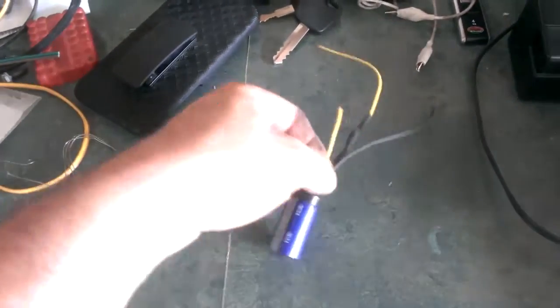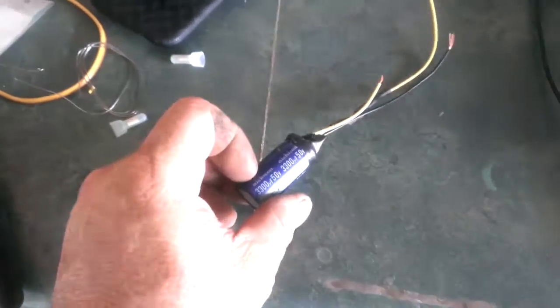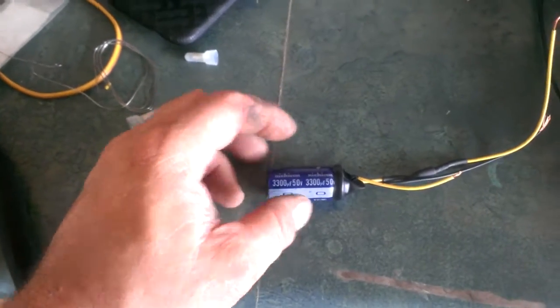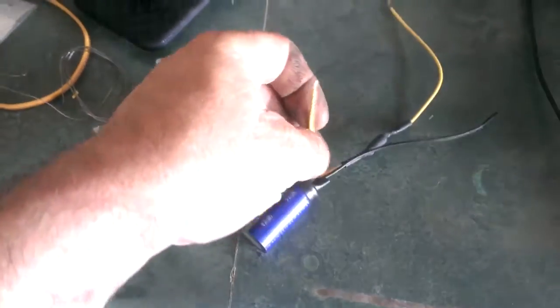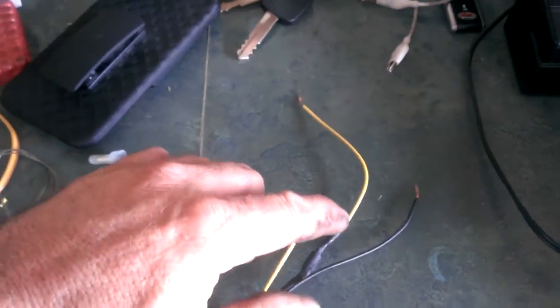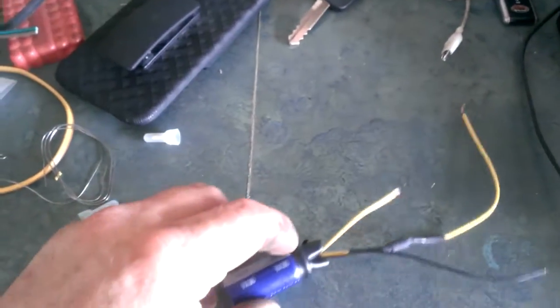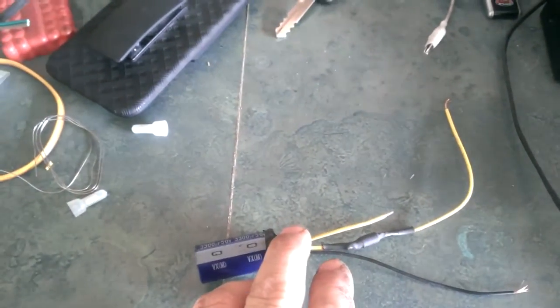So I'm going to modify the memory wire going to the car stereo. What this is: it's going to come from the 12-volt constant power from the car, go through a diode, charge this capacitor, and the other leg will be ground.